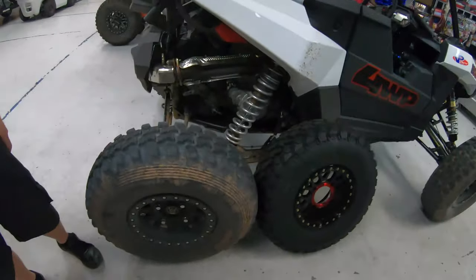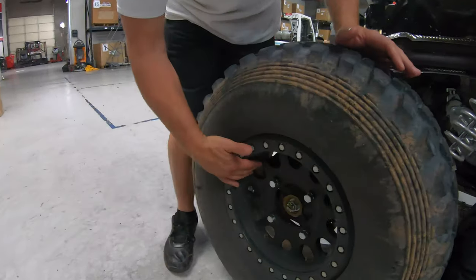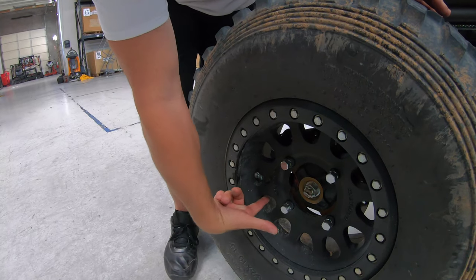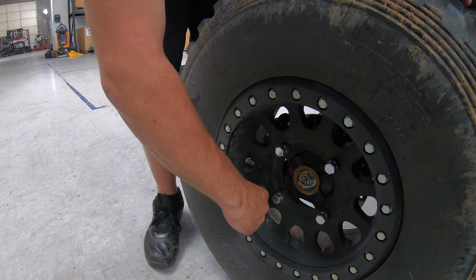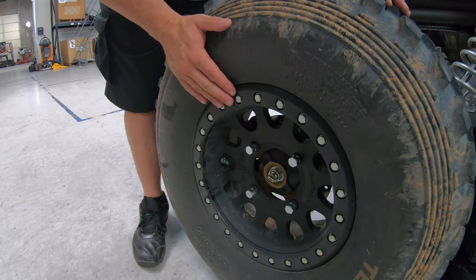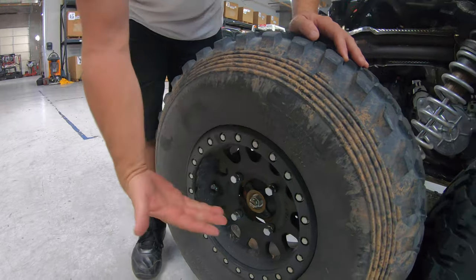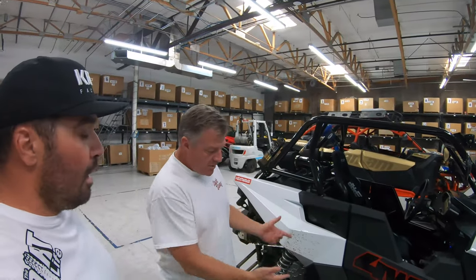If you can imagine the front tire pivoting when you turn the wheel — pivoting on one axis — if you take the tire out much wider and hit a rock, you have a lot more leverage to pivot. That's what this offset does. The wider offset gives the rock leverage against your steering wheel, and you feel that. But if the tire and wheel are in the right spot, there's no leverage for that rock against your steering and all of a sudden there's no feedback.